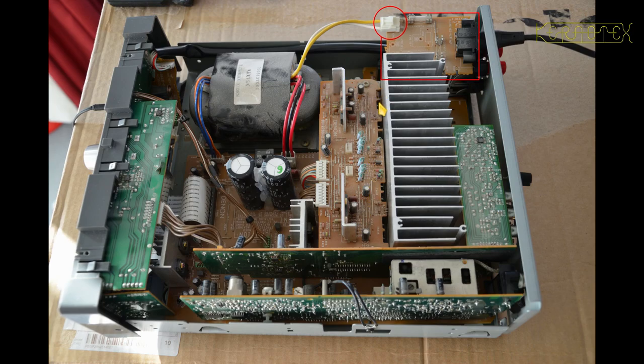That led me to think the fault was on the final output. Before going further, I must warn about mains voltages. You can see I had the lead plugged in here, but it wasn't plugged in at the mains. I wouldn't advise leaving it connected this end — if you don't see the mains lead in, you know there's no mains on the unit. If you leave it plugged in, you have to make additional checks.